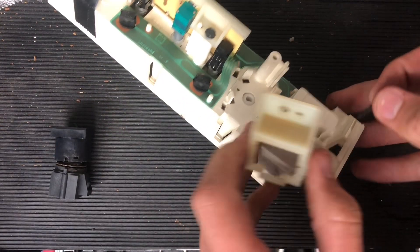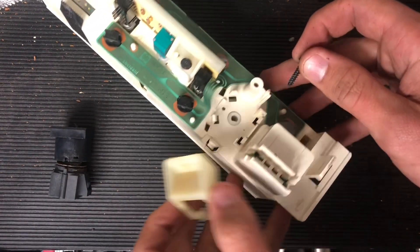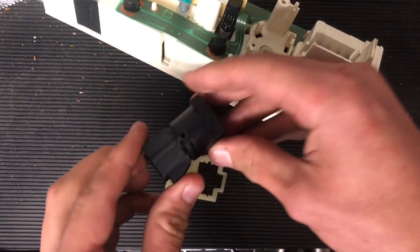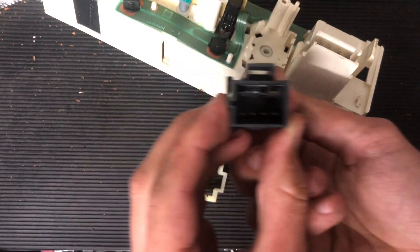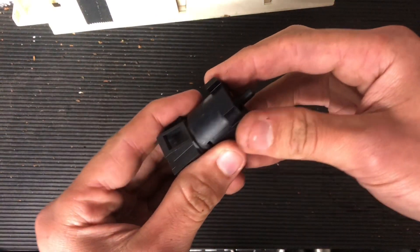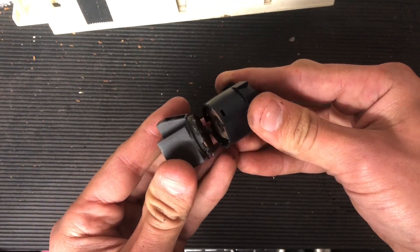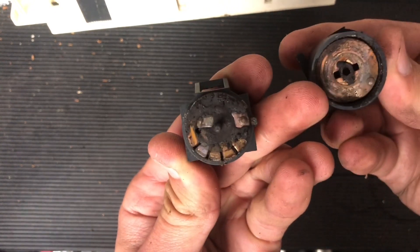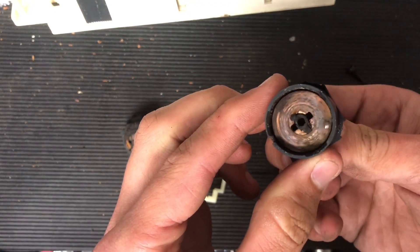This bolt or screw will be right here holding this little retaining bracket on, and keyed into that shaft right there is this switch — this is the blower motor switch itself. When I took the connector off I could tell instantly that there were some pretty burnt up pins in there, so I pretty much knew that was the problem. It wasn't until I actually undid these little clips here and popped this thing open that I really realized it's kind of a joke that they would think those little contacts are sufficient enough to switch that current for the blower motor.